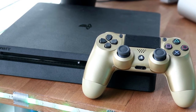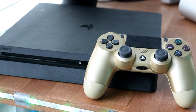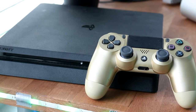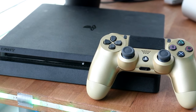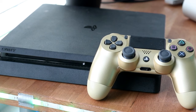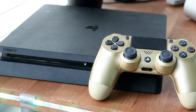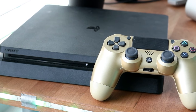The very first thing I would recommend doing, and that a lot of people have recommended, is to check your USB cable. Typically when you connect your PS4 controller for the first time, it requires you to plug the controller into the PlayStation 4, and then sometimes it tells you to press the PlayStation button. But if your console is still blinking white, just change out that micro USB cable for another micro USB cable.